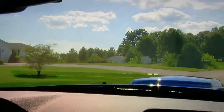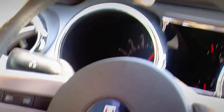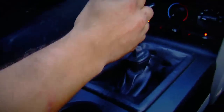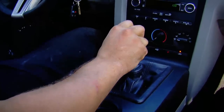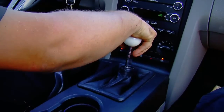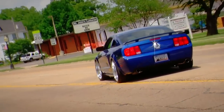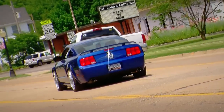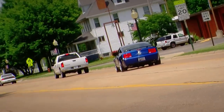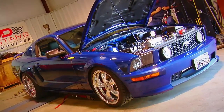We allowed the customer to put a few miles on it to break in the supercharger — Magnuson recommends around a thousand miles or so to make sure everything's happy. We didn't have any problems. I noticed first of all that the Centerforce clutch pedal effort is about the same but the grab point is very different, and it's actually a little touchy until it's broken in. The supercharger was an immediate difference — even driving the car gently during the break-in period you could tell that there was a lot more this car had to give. We took it back to the chassis dyno to see what kind of improvement we made.